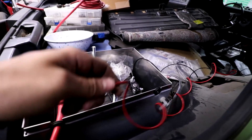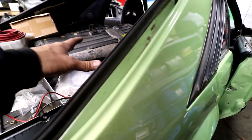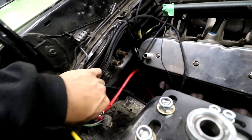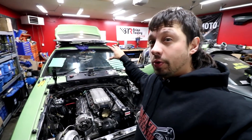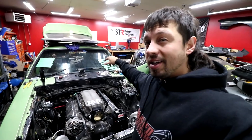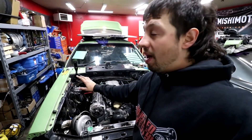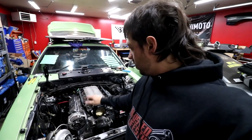So I'm gonna re-route this one to the back with the ground wire straight to the battery. I ran my Holley wires all the way to the back — I didn't tuck them in yet. This is just to make sure everything works, then we'll tuck it in afterwards. Cable to the starter — done. I have to figure out which wire here gives power to the inside of the car, to all those fuses on the inside, so we can still start this thing with the key. We need to figure out which one is power to the inside and which one is key signal out so we can run that to the solenoid.